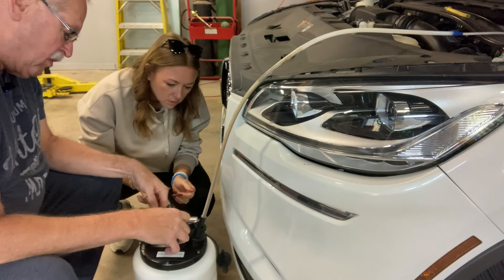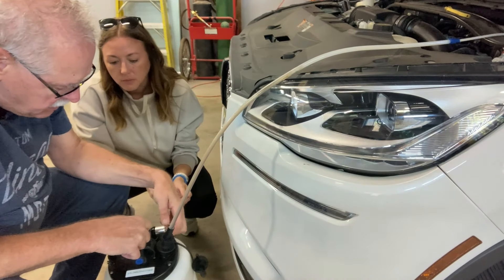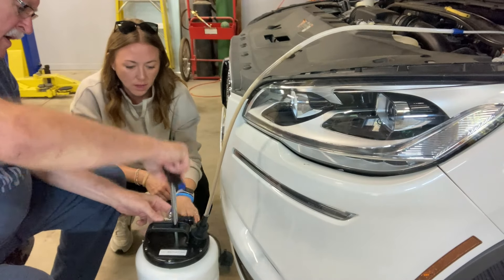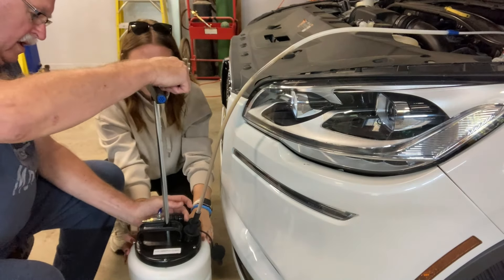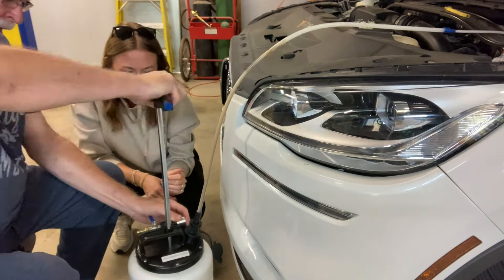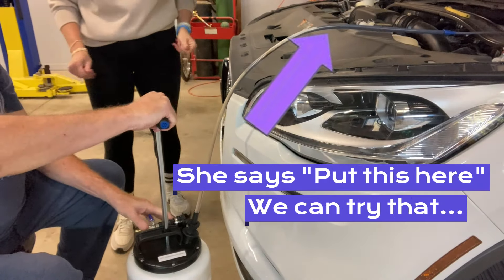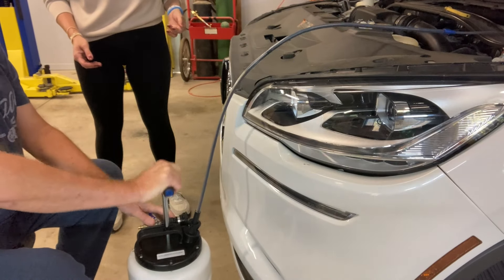This has a venturi — when you blow air through it, the air is supposed to come out here. I check the suction port and discover it is actually suctioning. The key missing step: you have to cover the chrome muffler port with the cap that came out of that hole. It fits perfectly over it. Once covered, you can hear the oil running in the tube — it's working.